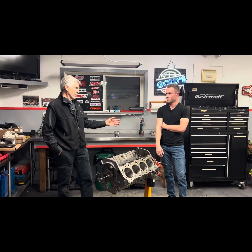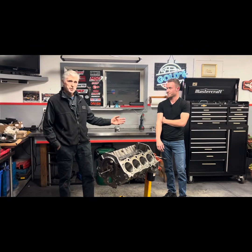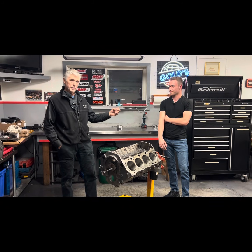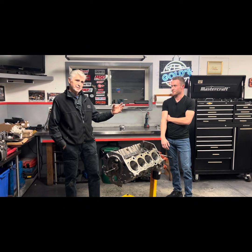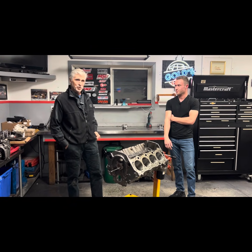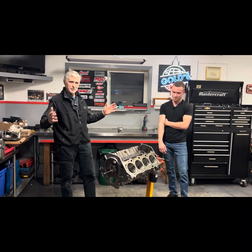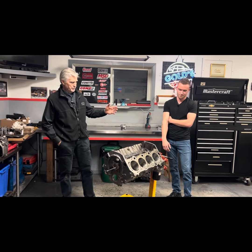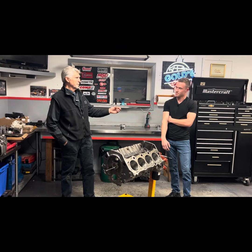When I come back here I don't have a torque plate, so I'm measuring without it and saying this thing's a little bit tight. These pistons are 2618 aluminum billet pistons — they actually grow a little more than some other metallurgies. So even though it wasn't terrible, it's got to be right, and that's why I took it back to Nolan. He basically took me to school on the subject, because normally I just bring the block back, measure it, and put it together.